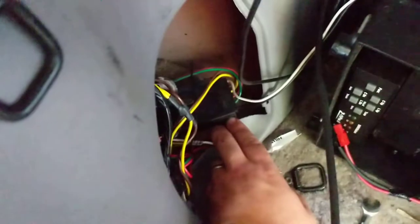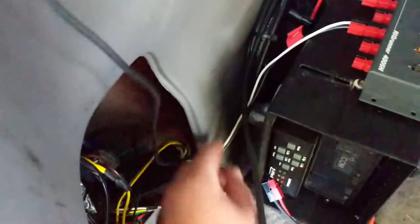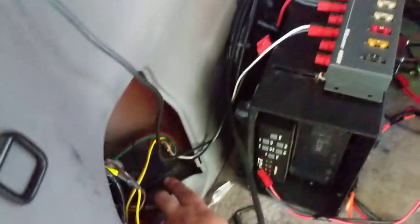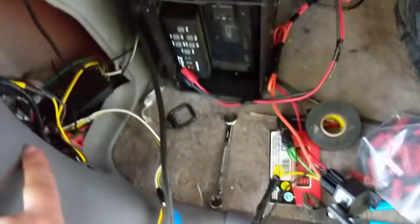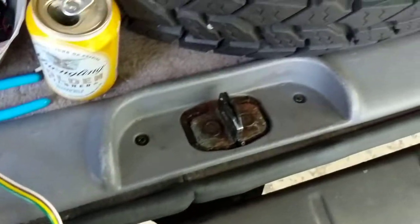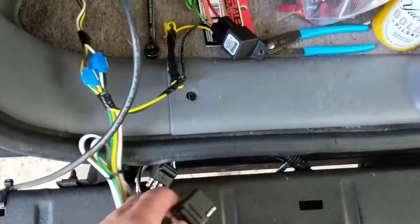This box has some relays or solid-state logic in there to feed power to the trailer lights. You get a flat 4 connector out of it — that's why we need 12 volts here. They say it takes 10 amps; I imagine it's more like six to eight, but over-spec it. So this comes up to my 10-amp circuit. There's another side for the other tail light so turn signals work properly. I took the trim piece off and ran it underneath and up the other side connected to the tail lights.